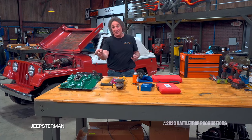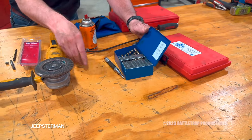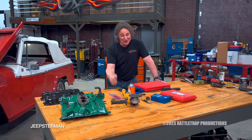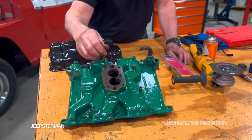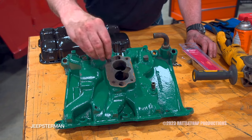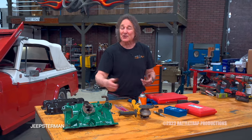So we eventually had to put in a helicoil to get metal threads back into the intake. This kind of problem can absolutely ruin your afternoon — it's going to take all of the tools on this table just to fix it. First, take a grinder and grind off the broken piece so everything is flat with the flange. Then take your punch and punch down in the center of the stud. Then take a drill and drill down in the center of the broken stud. Then take your easy out, stick it down in there, and hopefully you'll work the broken piece out. If it doesn't come out, you'll have to drill it out and put in new threads using a helicoil kit — drill with the proper size bit, tap the new hole with the supplied tap, then insert the threaded metal helicoil, which gives you threads in metal where they belong.